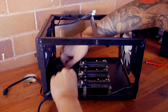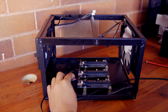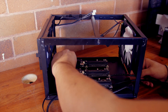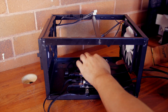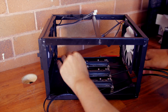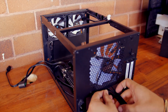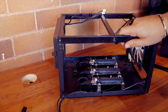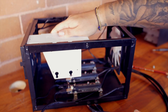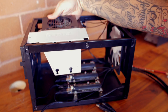Now doing some basic cable management - connecting the molex power to each of the PCI slots. This supplies the 75 watts from the PCI slot to all the graphics cards. Then running the USB cables underneath and out the back, zip tied at the end to keep it nice and neat. The PSU bracket I made is going to fit exactly where the side brackets go and we'll just screw it in to hold up the PSU.